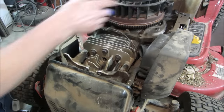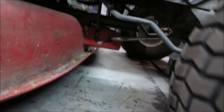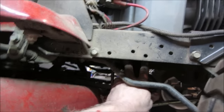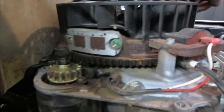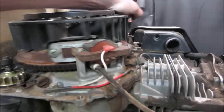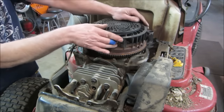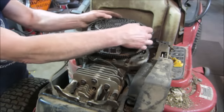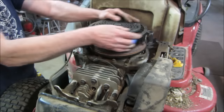The piston and connecting rod and crank are still connected to each other, and now it's freeing itself up — might not be totally fried after all. Let me take a peek underneath on the crank, make sure there's nothing going on with the pulley or flywheel jamming us up. It's not making a full turn though, and that clunk is not good — they're not supposed to do that. I still think we've got a rod problem.